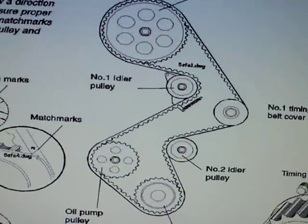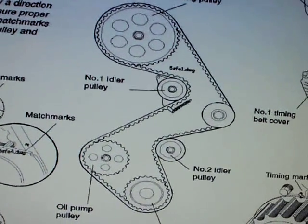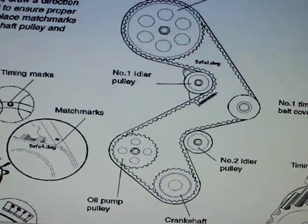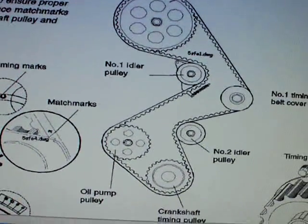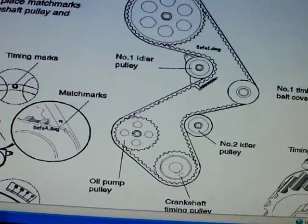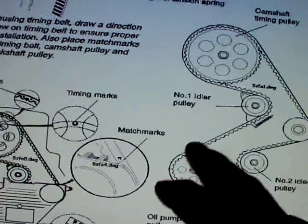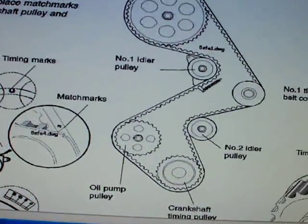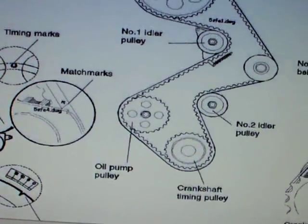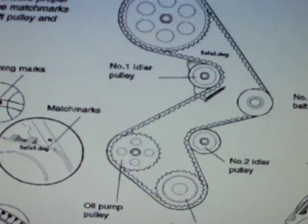After it's running a little bit, I didn't even add water to it yet — I just didn't run it long enough because I wanted to make sure the thing is running first. The next step is, if it's running good, put the top timing cover on. For the harmonic balancer, if you put a little oil on it, it should just slide right on — it's not a press fit. Then put the covers on, put the harmonic balancer back on, and do everything in reverse order. We'll also go over how to tighten the belts on the alternator and air conditioner.